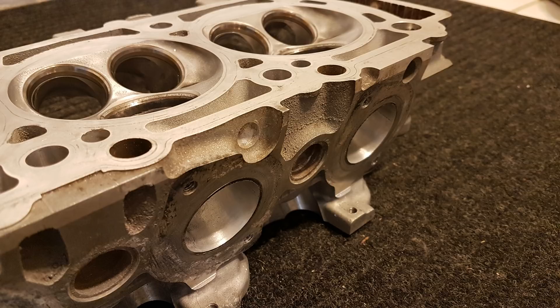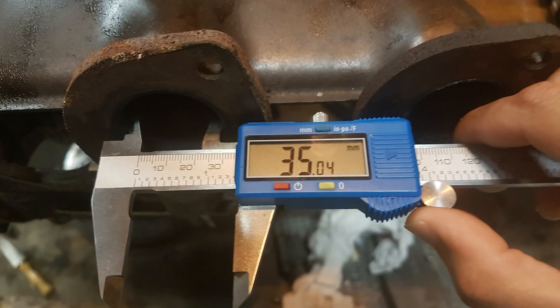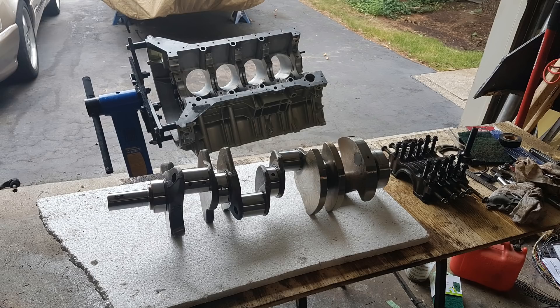I left the area at the bottom of the intake runner rough near the valve — I've heard that leaving that area rough helps the air turn into the combustion chamber better, though to actually test that you'd need a full flow test setup. As for the exhaust ports, I think opening them up and polishing still wouldn't make a massive difference because the exhaust manifold in this car is extremely restrictive — it's actually quite a bit smaller than the exhaust ports coming out of the heads. To make the best of these changes I'd need to go with a much larger exhaust manifold too.